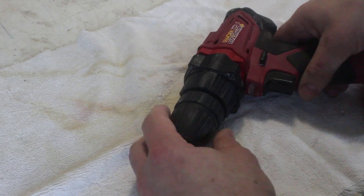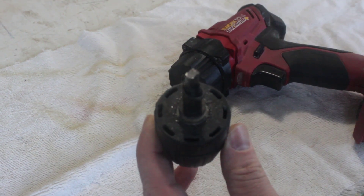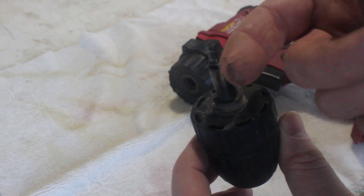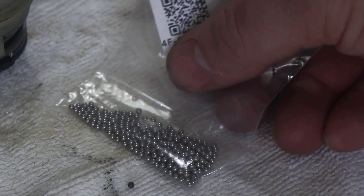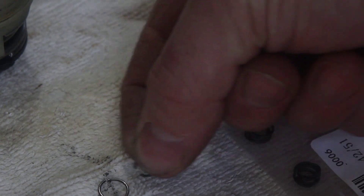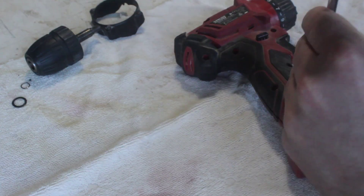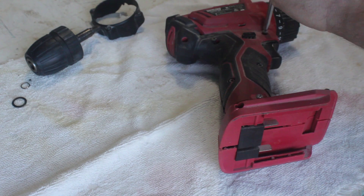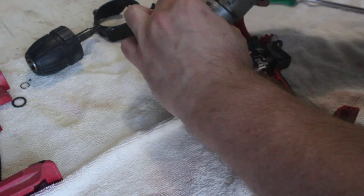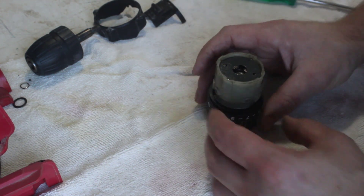The drill repair was a couple of months ago and during that time the thrust bearings got pulverised and the ring clip holding the shaft in the gearbox let go. I ordered some replacement 2mm bearings and some replacement rings. I measured the inside diameter of the old ring which was 7mm, figuring that was the only critical dimension — but that's obviously not right. The outside diameter is 9mm but they only come in 8 or 10. For the moment I'll reuse the old clip and I'll pin a comment once I receive the new ones to let you know what size it actually is.